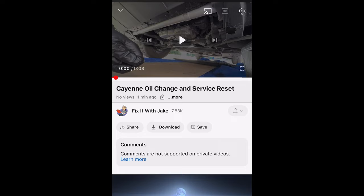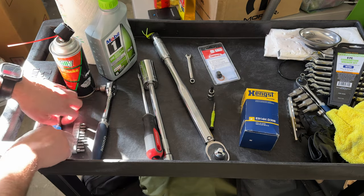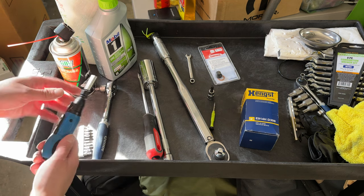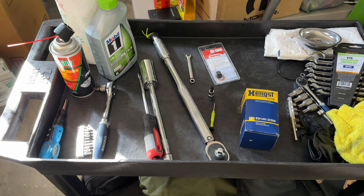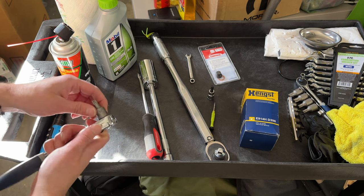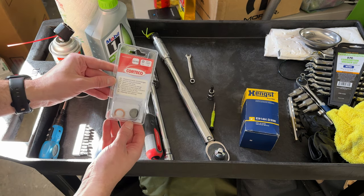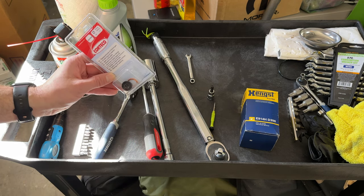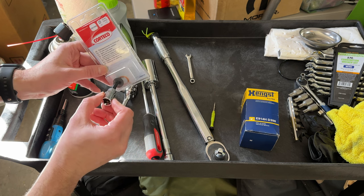I'm going to put links in the video description below to all the parts and tools that I use, so if you're missing anything just click on the links and you'll see exactly what was used. The first thing you're going to need is a T25 and a T30 Torx — you can put that on a power screwdriver or just a regular screwdriver — and that's to get the front panel off. To remove the oil drain plug on the OEM drain plug it's a T45. The replacement drain plug I have is compatible but uses a regular Allen wrench — I used a 6mm hex to reinstall.